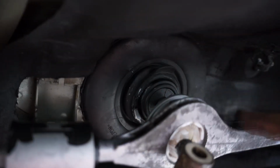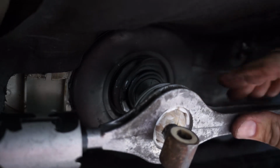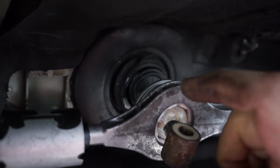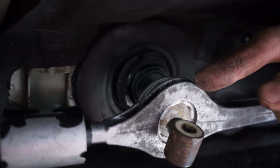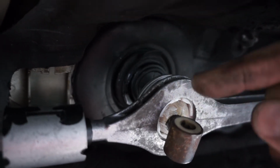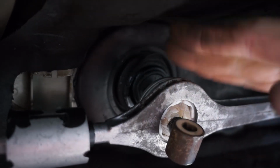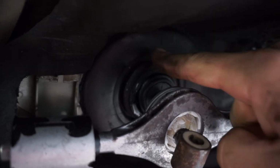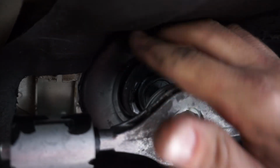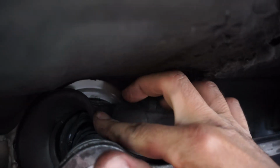Okay, so I put this bar in before putting the shift linkage. You can do it either way. It might be easier to put the shifter inside of the bar, or this plastic cup in here first. But you can do it. What I did was I mounted or placed the shifter up through the tunnel. I connected this rubber seal all the way around here. You can bend it back and make sure that the seal engages all the way around.